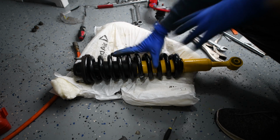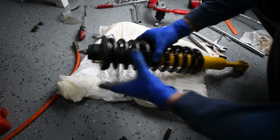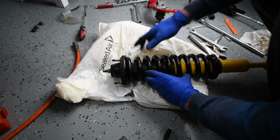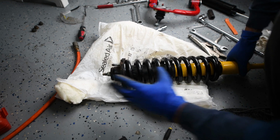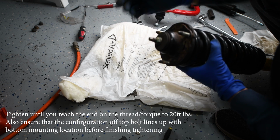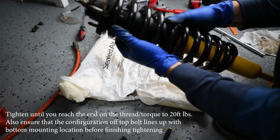All right, great. So put the spring compressor on there and compressed everything. Remove this top part off the old strut. Compress this spring. This is our aftermarket spring here. And put it on our new shock. And then tightened up this bolt with the vice grips there. So I think it's ready for install.